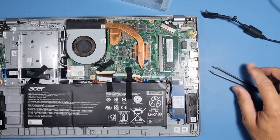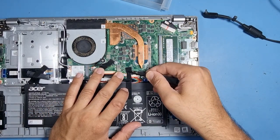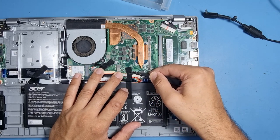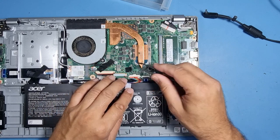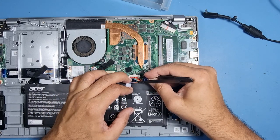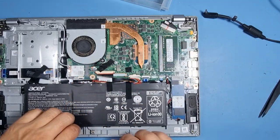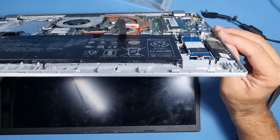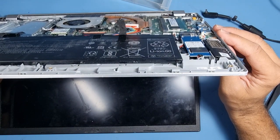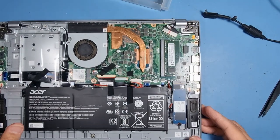Okay, let's remove this tape, which is under the coils. Let's remove the battery as well before we start doing anything on the machine. Just drain the power from the board as well: lift it up, press the power button. Everything from capacitors or whatever else can hold a bit of charge. Okay, so